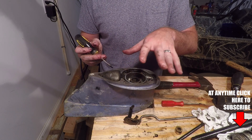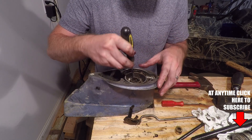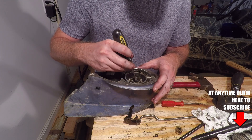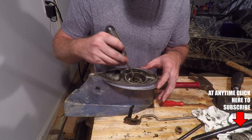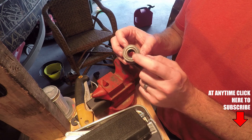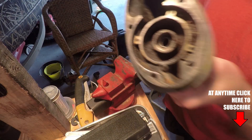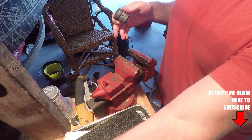We're going to start the rebuild from the top side. We're spraying this with brake parts cleaner and some is going down the drive shaft hole — that's okay for now because the bottom is still open. We're going to put everything back together top side first. There's one last seal you need to take out, located on this part right here. It's just like the seal that was located in this housing — same concept.